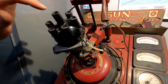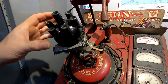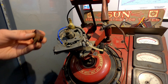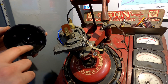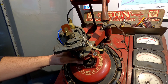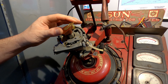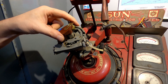Looking at the distributor, the big wire from the coil comes in the top, and then you need a way to get it to each of the surrounding terminals that go to the spark plugs. This is a six cylinder, off a TR6 — for a four cylinder, you'd have a corresponding number. Underneath the cap you'll have a rotor, and inside the cap you've got a terminal for the coil wire and one for each spark plug wire. As the rotor spins around, it distributes the spark to all of the individual cylinders. Spark goes in here, spark goes out there, goes to spark plug.